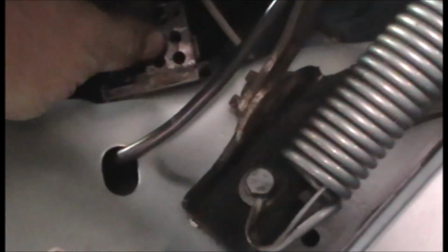Now, these cars can store codes. The diagnostic connector behind the left strut tower has its own jumper wire. You put it in terminal number 2, press the button for a little more than a second, let off, and it'll flash a code. There's a 1, pause, there's a 2, another long pause, and a 1. So I have a code 121.